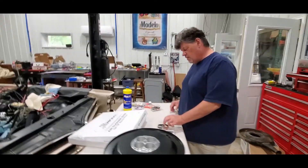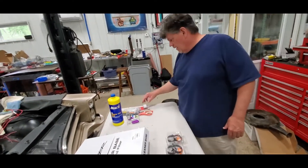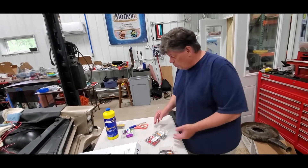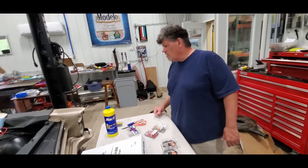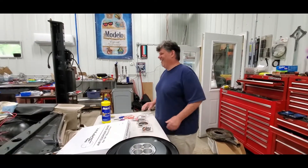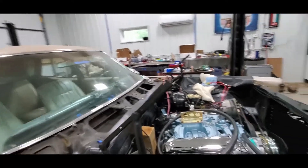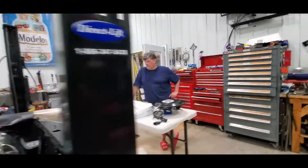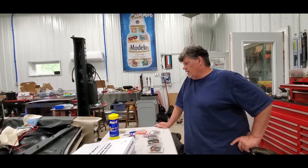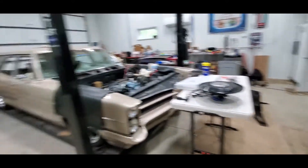We've been playing with different hose clamps for the radiator and sent an awful lot back. I ordered some stuff that certainly wasn't what they said it was. Also, from last week, the valve cover bolts were a little long, so I got some three-quarter-inch ones to try on some fresh washers. If that doesn't work, we'll do what I wanted all along — get those nice valve cover studs with bull-nosed nuts. The only downside on some engines is clearance issues, like an LT1 where the alternator is literally right over the valve cover — real pain.